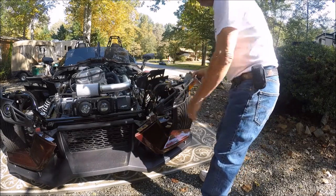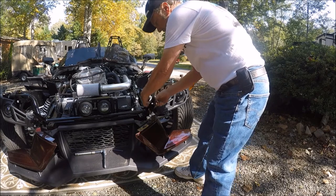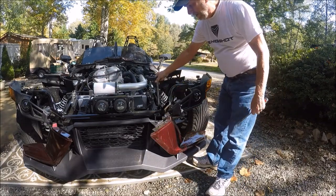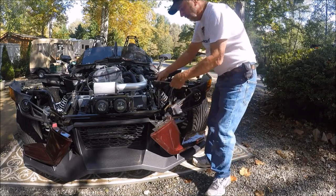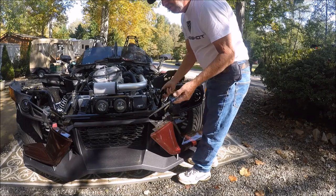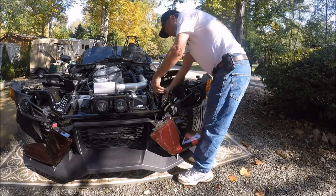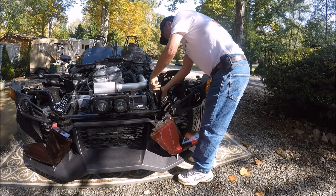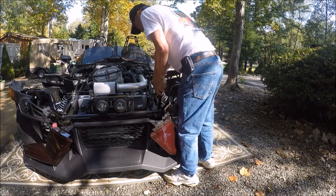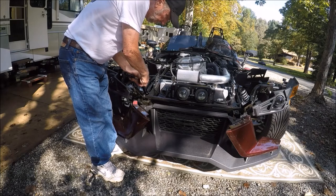We take the hinge plates off both sides — I'm going to do the driver's side now. Take the bolts loose on both sides. Then take the rear link arm, leaving the front link arm in place. It's hard to get a 14 millimeter socket down in there, so a tip: you can use an open-end 14 millimeter wrench in there, but a screwdriver jammed in there will hold it firmly. Get your quarter-inch Allen and a cheater bar, hold it firmly, and then you can loosen it. Do the passenger side as well.